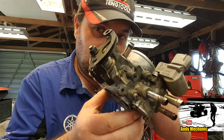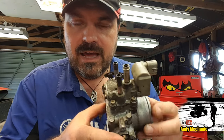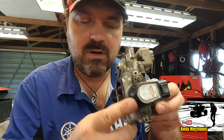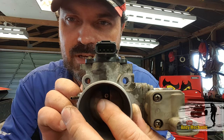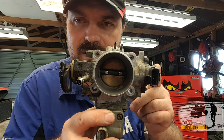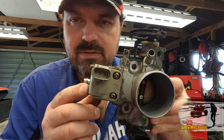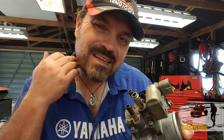So you'll find this is the throttle body off the RAV4, but throttle bodies are all pretty much the same, very similar units. And you'll recognize this thing here. This is the TPS. There's plenty of videos that I've done on TPS units. That one is the 4-pin TPS, with an idle switch inside. At the other end, you've got the spindle, so you've got the TPS on this side, and you've got the throttle spindle, and dangling underneath we've got this idle speed control valve.